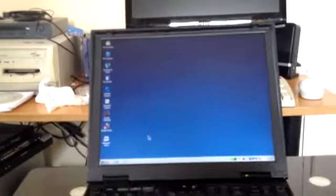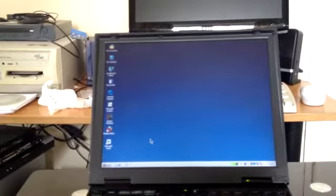Well, no, of course I had to fdisk the drive. I had to fdisk and format it as FAT32. I then had to make the drive bootable. Well, actually, no, I didn't. But I had to copy the Windows 2000 setup files from the i386 folder on the Windows 2000 CD to the hard drive. And then once I'd done that, invoke setup by using the winnt.exe file.